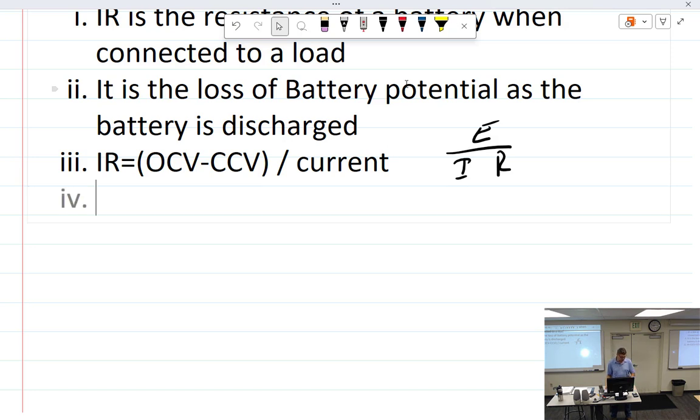So when we want to calculate the internal resistance of a battery, when you were talking about that, my mind instantly went to Ohm's law, just getting the open circuit voltage and then instantly dividing by current to get my resistance. But we're using those two values, open circuit voltage minus closed circuit voltage, and then dividing. Yeah, so it's the difference between open and closed, which is what's left over.